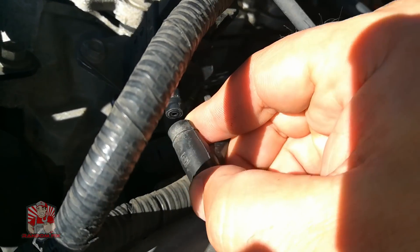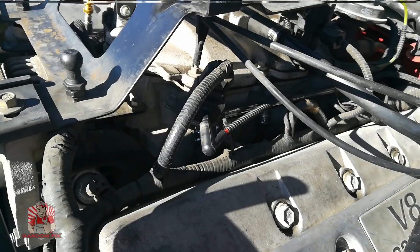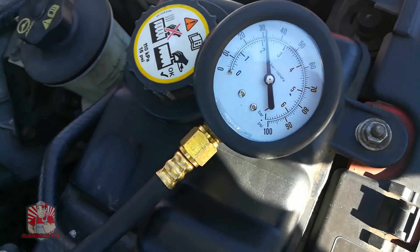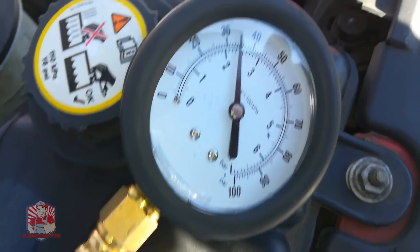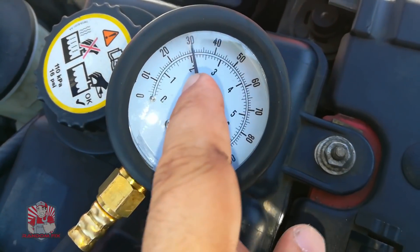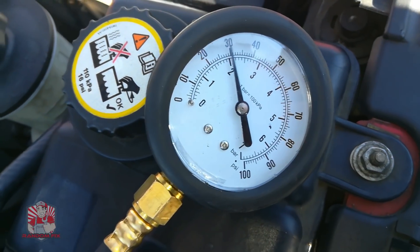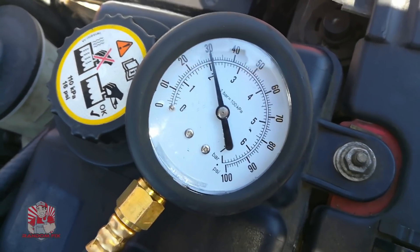Let me go ahead and get the motor started and I'm going to show you what to look for. With my motor on, the fuel pressure instantly raised up to about 30 psi. So there's our fuel pressure — whenever I give it gas you see a spike like that, but it shouldn't go up really beyond 40 and shouldn't drop really under 30 at all for you to have a good running motor.